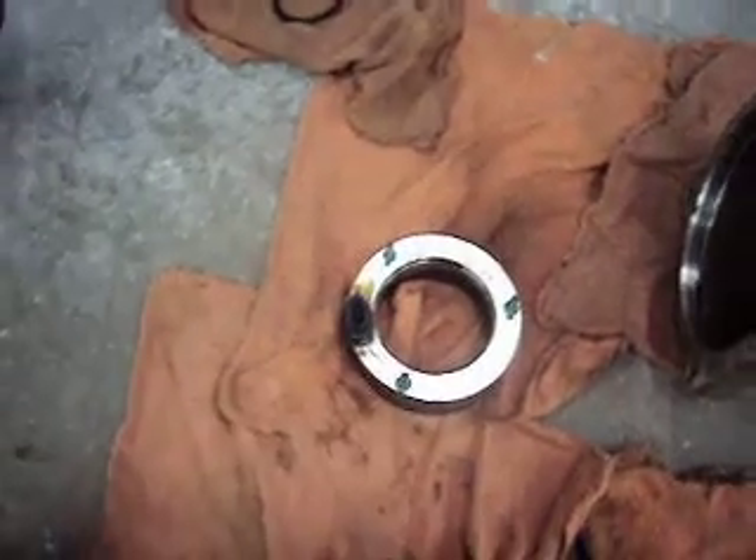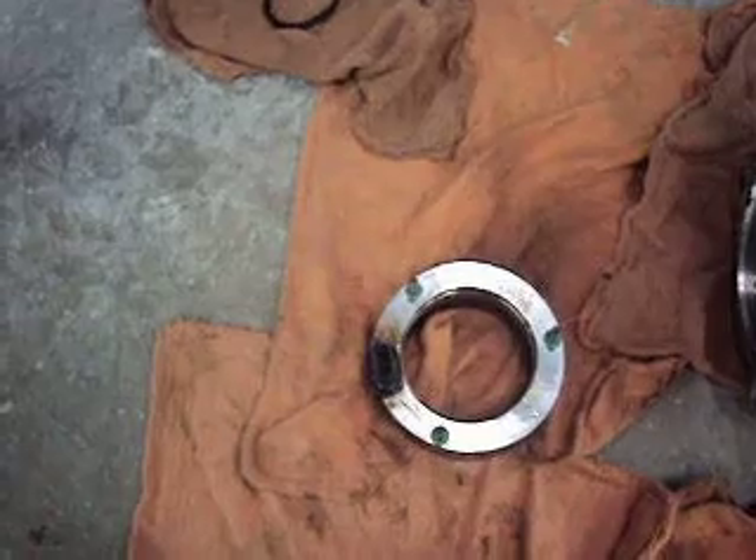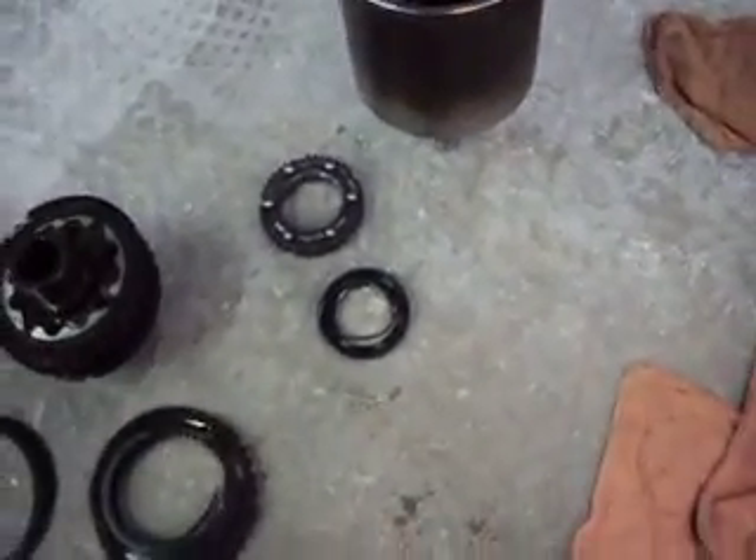How it does that is there is a magnetic clutch assembly here. The problem with this vehicle was that the clutch pack froze up and made the vehicle undriveable. In fact, it twisted the drive shaft up like a pretzel, because when you try to turn a corner and your four-wheel drive is totally locked in, something has got to give. What gave on this vehicle is the drive shaft basically wrapped up, and that was because the clutch assembly was locked due to overheating.